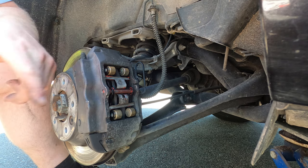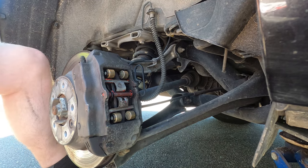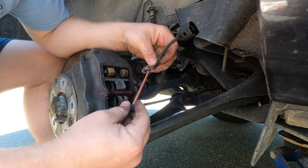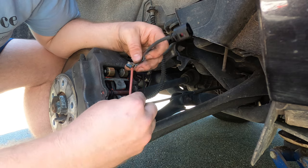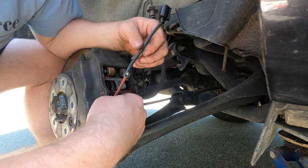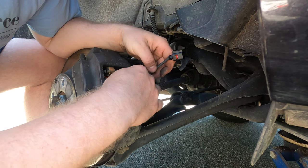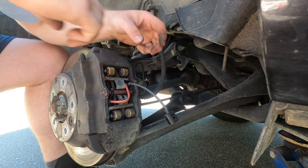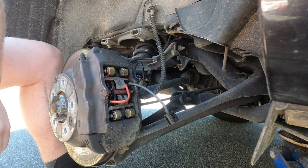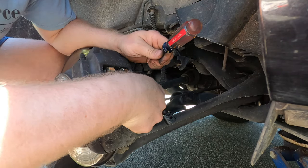I think I'll do the other rear first since this was such a pain in the butt — that way I can end on the fronts. I almost forgot the sensors. Same as before: the thick side goes in towards the rotor, just goes in place and clicks in by hand. That one has a lot more sticking out of it, so you can get a screwdriver in here and get on the plastic rather than pushing on top of the wires. There we go — popped into place.